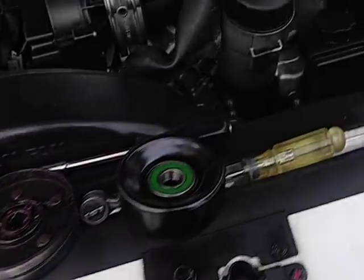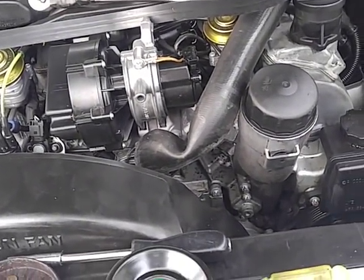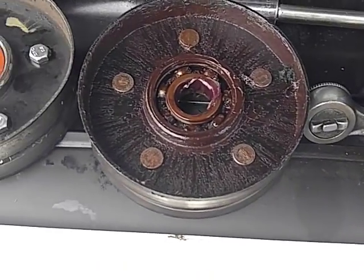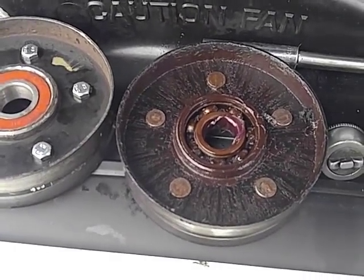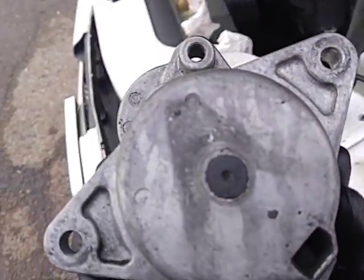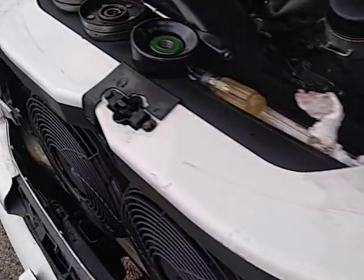Anyway, back to work. We drove this Mercedes from Phoenix to New York, and just pulling into New York State — it's 425 miles, about 750-800 kilometers across the state — the idler tensioner bearing starts going like Morse code. Knowing that a new one is $125, even expensive on RockAuto and made in China, I said I'm not spending $125 on a new tensioner when all I need is a new bearing in the idler pulley.